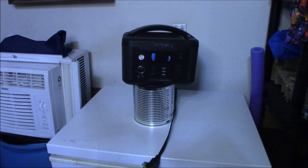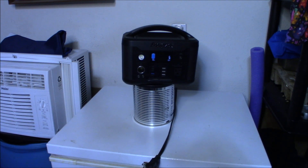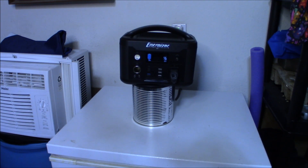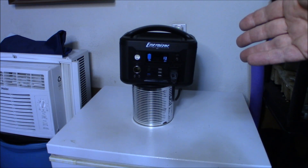Let's try something else. I've had the freezer unplugged for about 15 minutes, just enough so it kicks on. I have the power station sitting on an old metal coffee can — by the way, if you can find those old metal coffee cans, save them, they make awesome hobo stoves. Let's plug this in and see what we got. We got 355, then it dropped to 101, 96. You did get that initial pump with readings in the 400s, and it took it fine. These things do have a decent amount of overhead, so if you push it a little bit, that initial surge will be just fine. Battery's still at 98% after all we've tested, running at 83 watts.